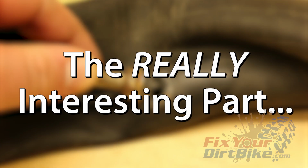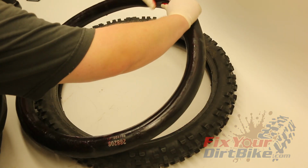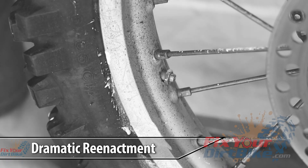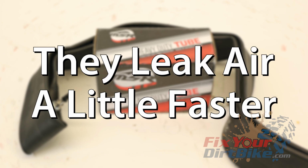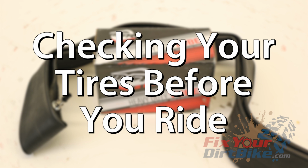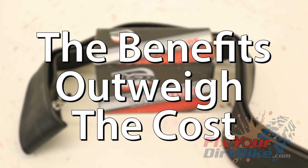The really interesting part, this tube is 6 years old with a ton of hours on it. I installed this tube with rubber grease for a buddy. He let the tire slip and the valve stem ripped. Other than that, this tube is still in perfect working order. Natural rubber does have one drawback. They leak air a little faster than synthetic, but this issue is easily fixed by checking your tires before you ride. Natural rubber tubes do cost a little more, but the benefits far outweigh the few extra dollars.